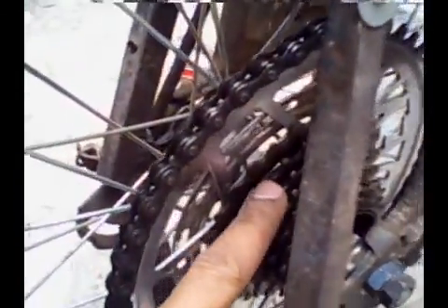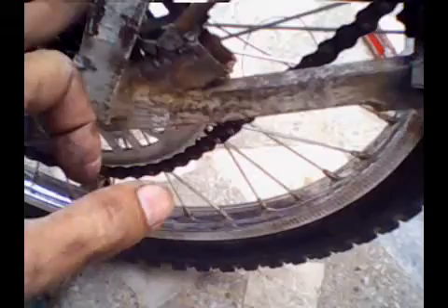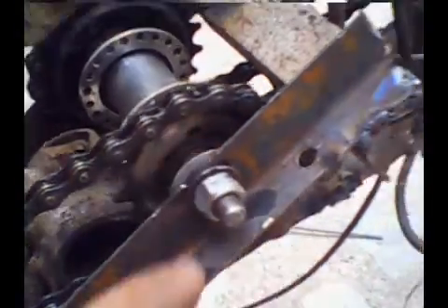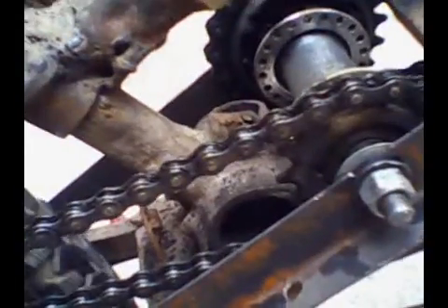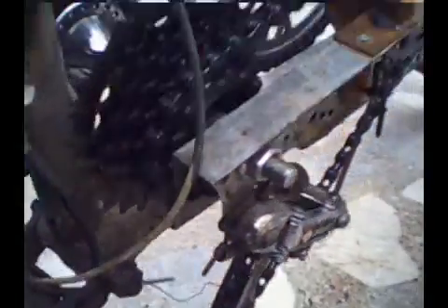I have also done a modification to the seven-gear cassette: the last gear is a sacrificial gear that has been welded to the bigger gear in order to get the approximate RPM I want at the rear wheel. It is being supported here, and as I show you — this is not a freewheel on the cassette side, though at the rear there is a freewheel.